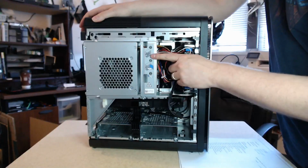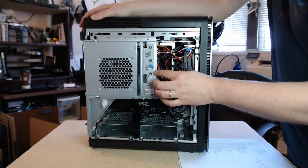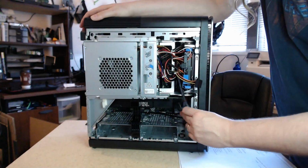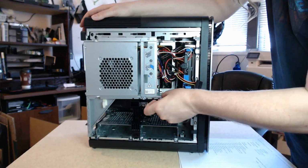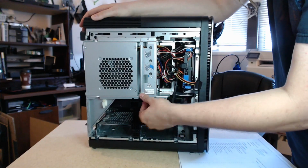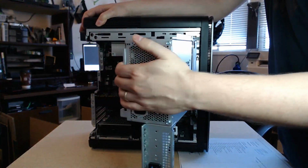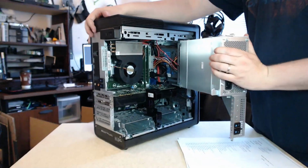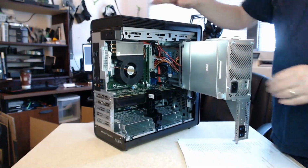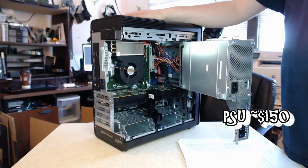To open this one up, it tells you to make sure that those locking clips are all in the up position and then pull forward. Go carefully because the cables are right in where the metal turns, and some of this metal's a little sharp. It'll feel resistant, but believe it or not, that's actually okay. So there we go. Now we're looking at the insides.